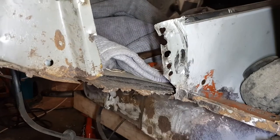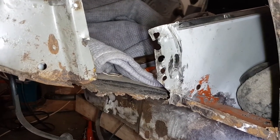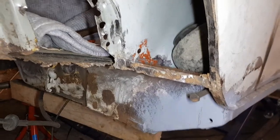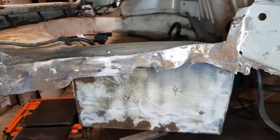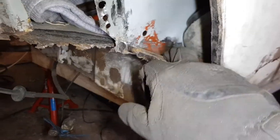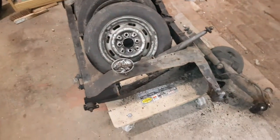I think that was the last bit - I did destroy the edge of the plate there, but we can fix that with a bit of weld. I don't think you'll actually see it when the seat base is in anyway. I've got all the bits out I wanted. My next step isn't going to be putting the wheel arch in - it's going to be fixing the floor: that bit all the way up to here, a bit in there, and a bit here.